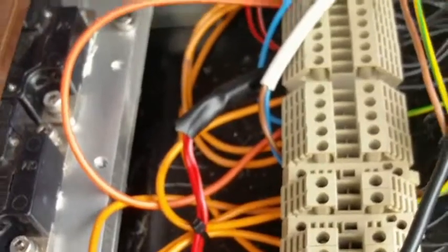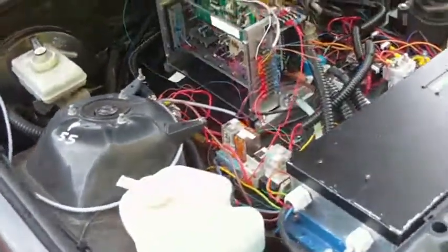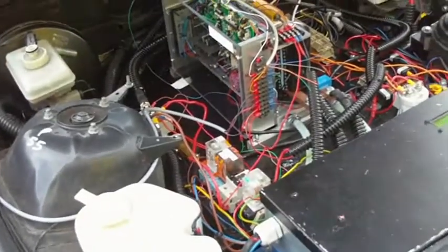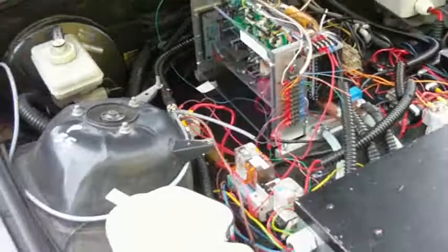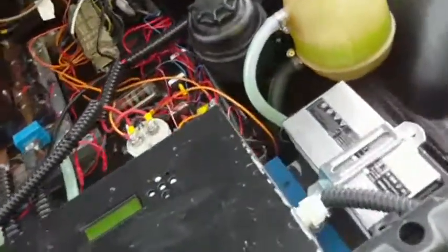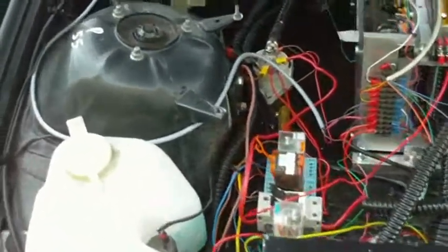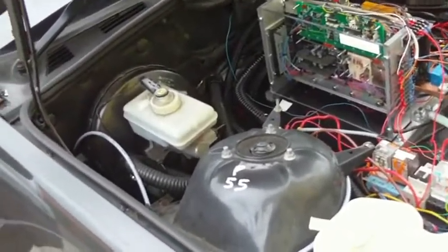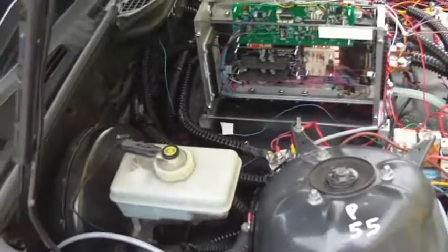There's a pair of anti-feedback diodes in there that prevent them back feeding power. So that gives me some added safety features — I've got two contactors breaking the traction circuit now if I had to turn the key off. It also means the car is basically turned off when the key is off, so there's no traction power up here. And if we were to have a crash, our impact sensor in there would basically break the circuit here at the main contactor and in the back, ensuring no hot traction cables under the car if they had to cut the car up or if the cables got damaged.